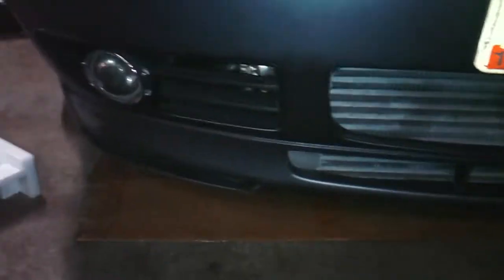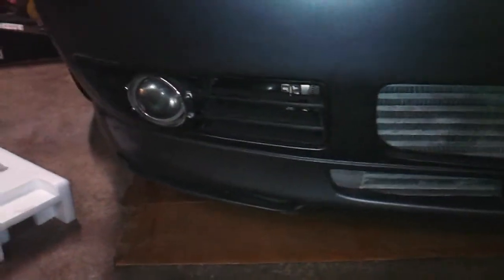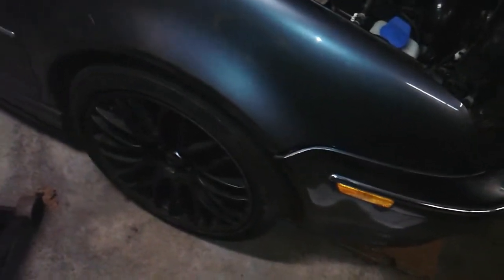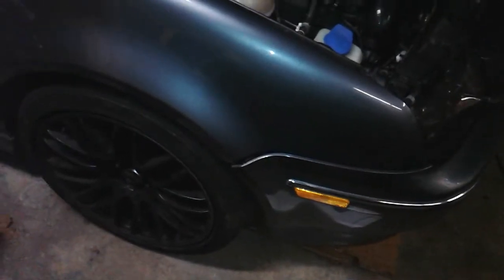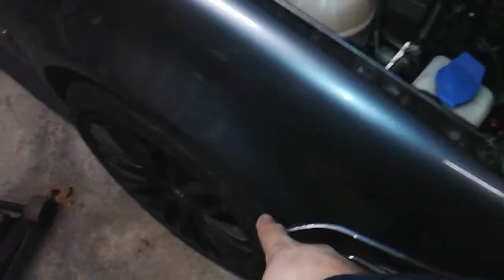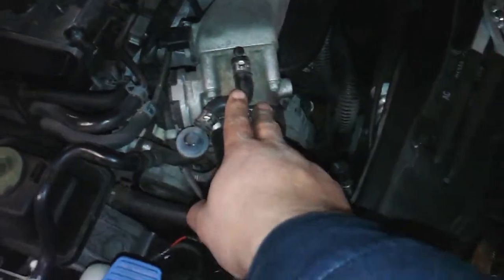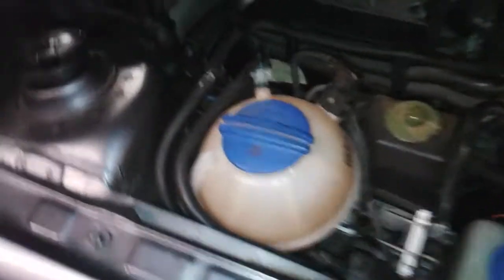So both lines go down through there to the left, go back, which goes back into, I believe, it's called the pancake pipe that was back there. Well, that got taken out and I put the aluminum pipe in all the way. Both of them come up. One comes up through here, goes to your intake manifold. The second one goes back here.